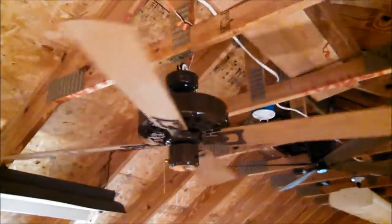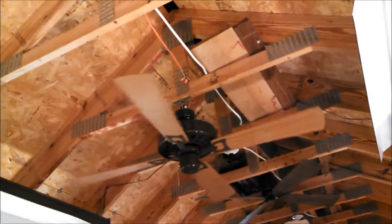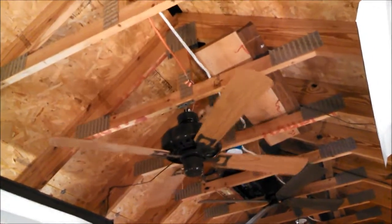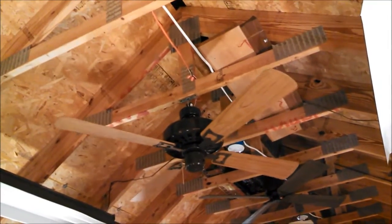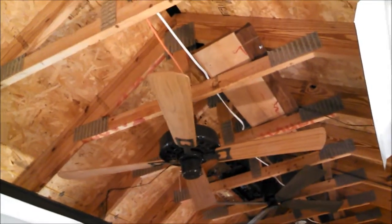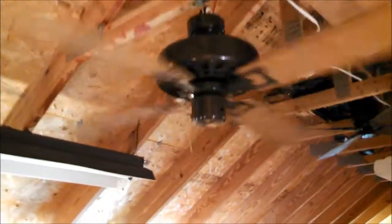If you're interested in comparing the years too, I need to see if there's a year on it. It's funny, the only ones I have with the gold motor are Haciendas. No, I've got a gold motor Sea Island somewhere in storage. I've never tested it though. It's interesting because even their American-made fans used different motor types that had different speeds. They just didn't seem to care about being consistent. Low reverse, 0.44. So it looks like it's going to draw a little more in reverse. Medium reverse, 0.59.